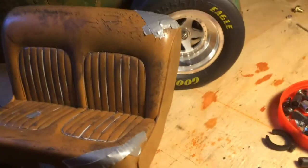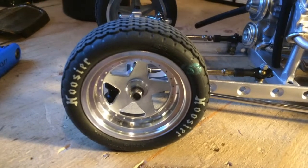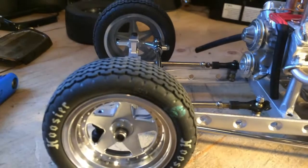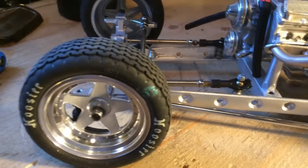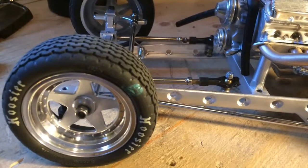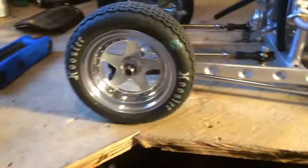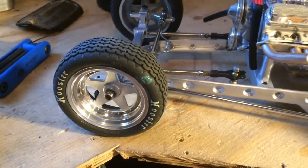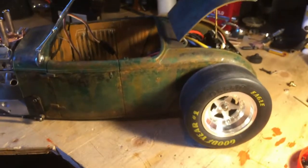You can see a little more of the patina from the other side and more of the interior patina. The seat even has actual real duct tape - it's actual duct tape patina. For the front wheels I'm running some Hoosiers with inserts and they're front buggy wheels. To fit the Kyosho wheel onto the spindle of the Tamiya I had to do a little bearing finagling - I ended up with a Traxxas bearing, 5x8x2.5mm, which works just fine. If you need to contact Kyosho America, the part numbers are SCH005 and FCH006 for the front and rear.